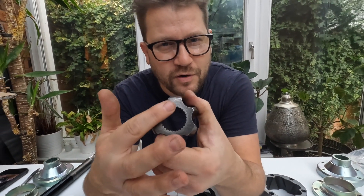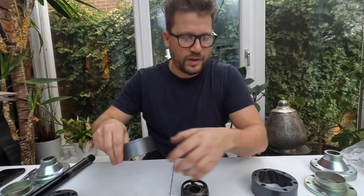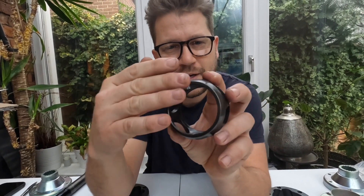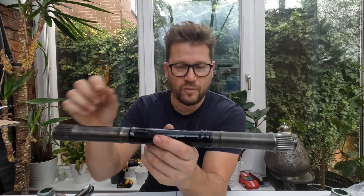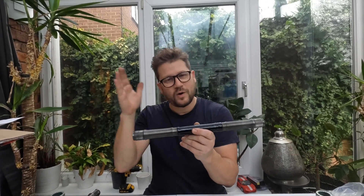It's really quite tricky here because you've got so many differences. If I look at this, you can see this has got a completely flat face on it, but look at this side — it's got a raised part as well. That is the same with all of these bits. We've got a groove on here, and even these are slightly different one side to the next — one has a slight chamfer, one is more flat. We've figured it out — took a little bit of time. The final thing was which way around this goes: one of them has got two ridges, this one has nothing at all. So this goes to our hub side, this goes to our engine side. That was the hard bit — now we can put it back together.